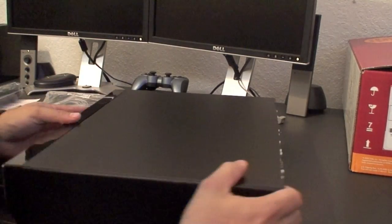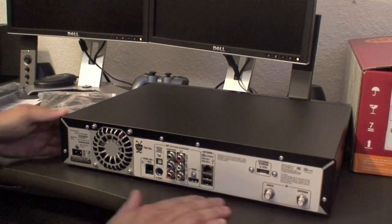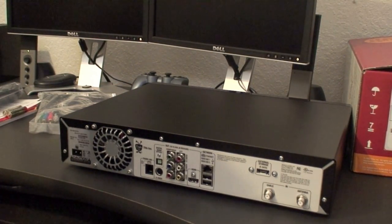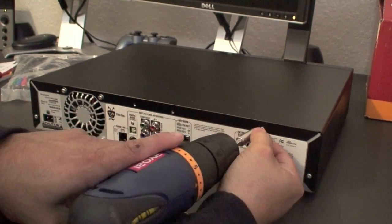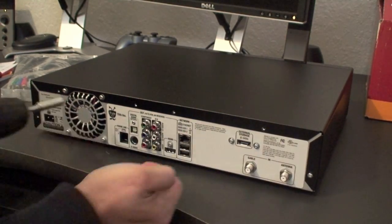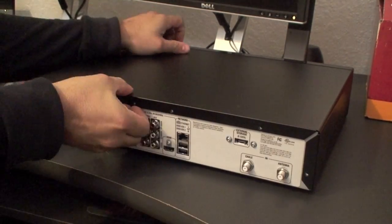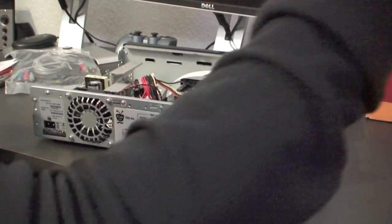So here I have the TiVo HD. I will turn to the back of it and we have here all the screws that we need to remove. I am going to get started and take that out. Once you remove the screws, you are going to find all these right around. There are four on the power supply that you don't need to remove. Take out the cover — it might be a little hard to take out at first but just work at it, you can pull it right out.